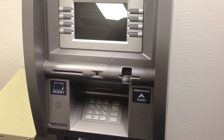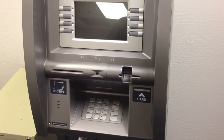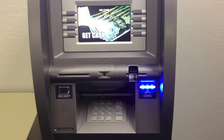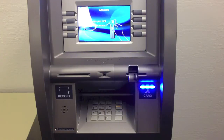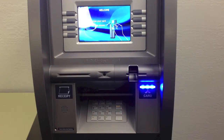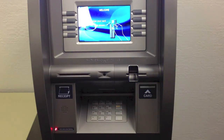With the top of the machine hinged back in place, go ahead and power on the ATM and close the top. Once the ATM boots up and returns to a welcome screen, you should have the blinking light on the card reader showing that it's working. The next step is to go into the operator menu and set the new type of card reader — enter the operator menu.